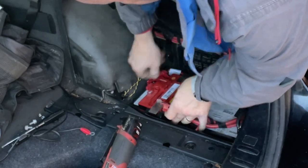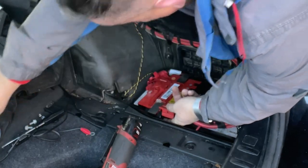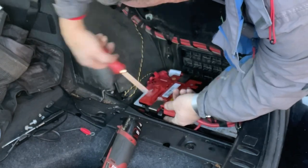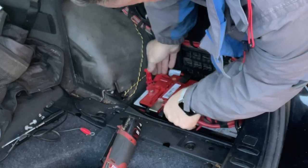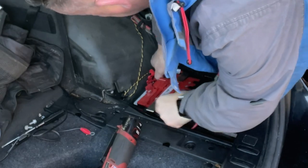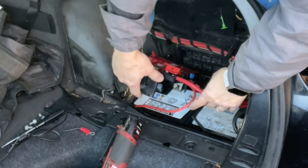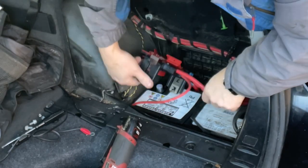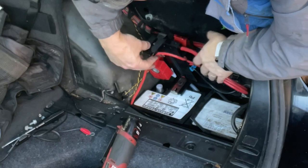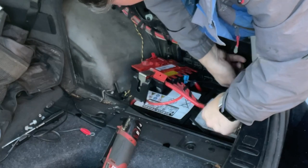This end's still attached, it's not completely come off - I've got to get my screwdriver in there again and give it a good wiggle. The one nearest to us is still just caught on the top of the battery. Push down and pull it out - there we go - then twist it and that should come away. It's just a little bit sticky on that terminal. Now we're going to need to give ourselves a bit of room to get that battery out.